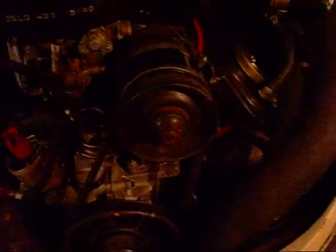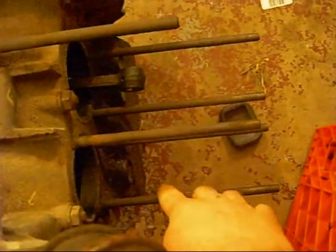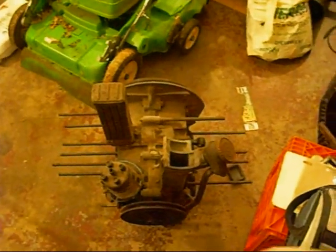You're going to pop your valve covers off. On this bare 36 horse block over here — you have cylinder one, cylinder two over here, back here is cylinder three, and over here is four. Your firing order when the engine's spinning is one, four, three, two. So as the engine spins: one, four, three, two.